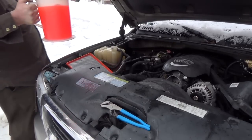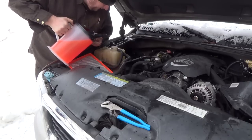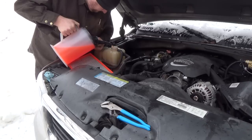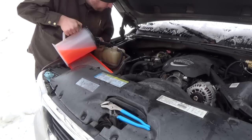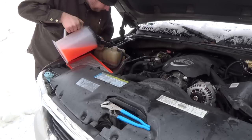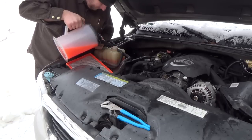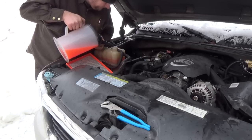All right, another 3.5 liters, we'll say, almost a gallon. Now, I know somewhere on this engine, or these engines, there's supposed to be one of those bleeder valves. I can't find her. If it's under a stupid cover or something, I don't know. I can't seem to locate it. I was actually thinking I could probably pop out that temperature sensor thing on the far side there. That would bleed a bit of air to that side perhaps.